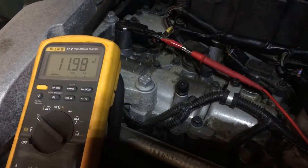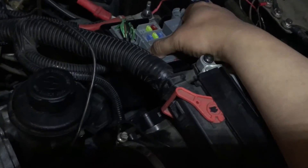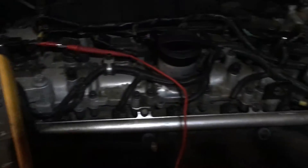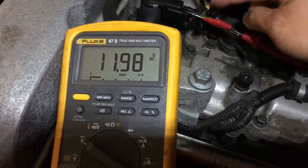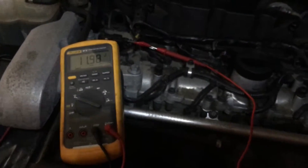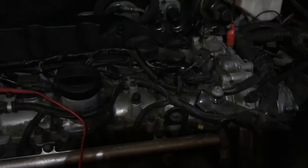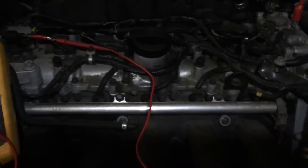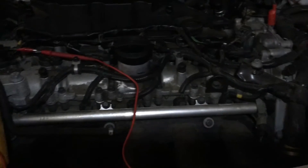So if you've ever had the same issues going haywire, you might want to check the junction box first and use a multimeter to make sure you have 12 volts. The other line is computer-controlled ground, so check that box first. I'm not sure why it went loose, but I'm about to find out. At the end of this video or in my next video I'll follow up on the fix. If you have an intermittent code like this, check those connections first.